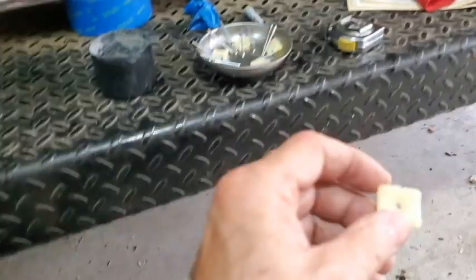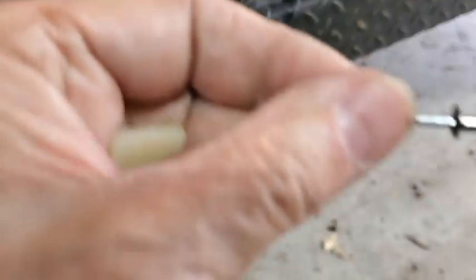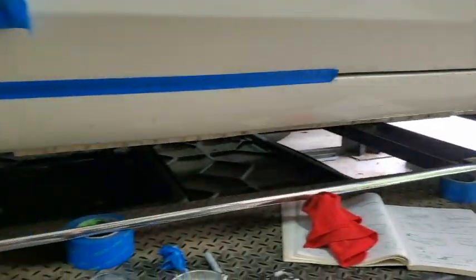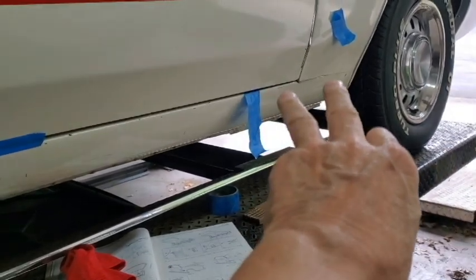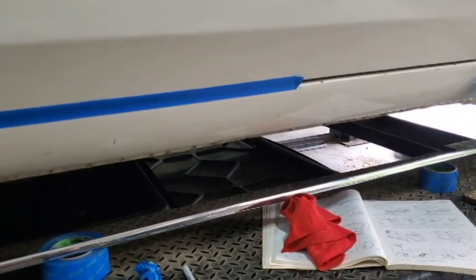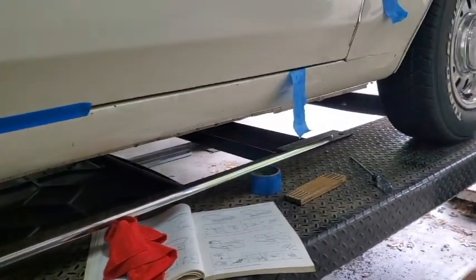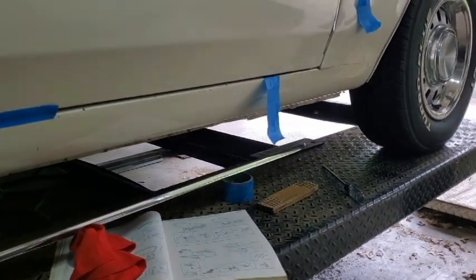Now I'm at the point where I have to rivet on these little plastic clips with pop rivets. I measured out the distances — I've got eight of them. Anytime I'm switching between panels I wanted them close together, so I've got two close together at one end, two close together at the other, and the rest evenly spaced. I've got a piece of tape across as a reference line, so I mark my hole, drill it, put the pop rivet in, and repeat along the side until all eight are in.